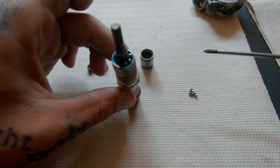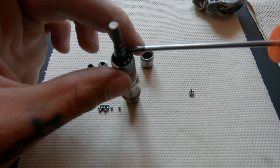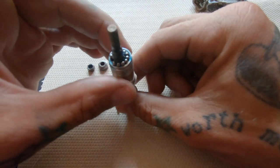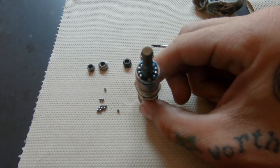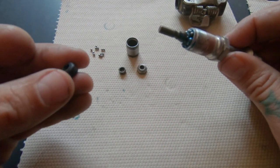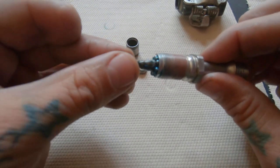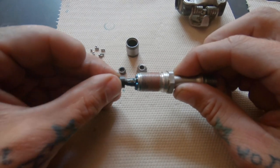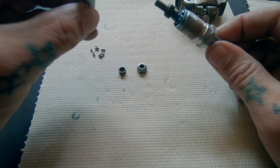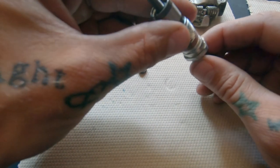Slide the cylinder into place until the bearing races match up so there's plenty of room for all 11 bearings. With all 11 in place, slide that cylinder up the spindle a little bit and you should see all the bearings fall into their seat. Next, slide that plastic ring back on with the convex side facing out, away from the bike. The outer edge of that piece of plastic will help the second set of bearings stay in place. Then slide that other cylinder on, which has races on either side for both sets of bearings, snugging that first set into place.